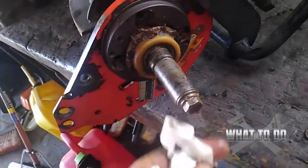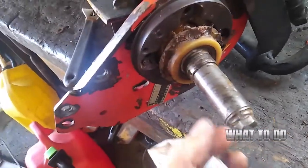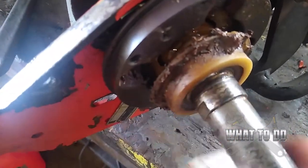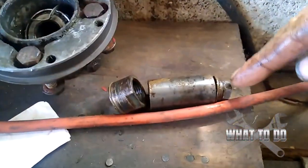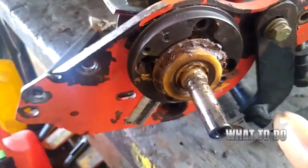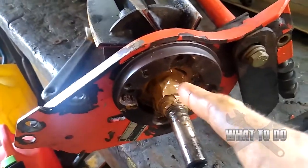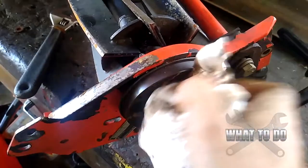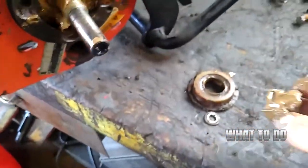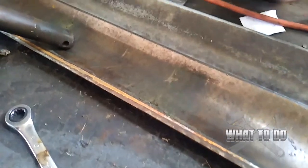Basically the way this is going to work: you're going to have a bolt right here that you've got to take off. This is a sleeve right here, and then the sleeve will come off. Then you're going to need to get an adjustable or a wrench on this piece, and it unscrews out. Once you've got them off, set them down in the order that they go back on, or take a lot of pictures so you don't forget. This piece will slide off. Underneath all the grease is going to be a spring — clean it up so you can see it. And that spring will pull off just like that. Set everything down in order.